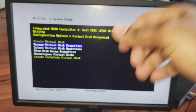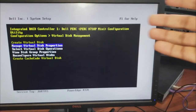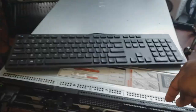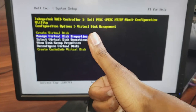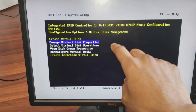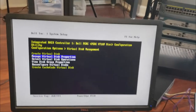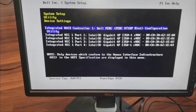If you didn't have a RAID configured, here's where you'd click 'Create Virtual Disk' and it asks what RAID type and how many disks to use. Everything is pretty much good to go — we've set up RAID 6, we've set up iDRAC, we've enabled SATA and the internal USB. Now we're going to reboot the server and tell it to boot into the USB where our Proxmox installation is.